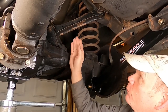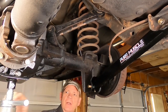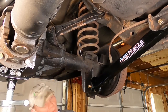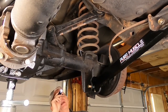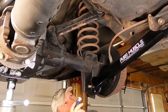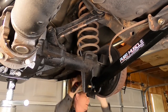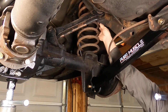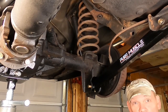I'm going to try to find the sweet spot, release the tension on these arms, and tap these bolts out to get the trailing arms out. I got this bolt here on top of the diff out — just tapped it out, basically just adjusted this under-hoist screw thread. Got as little tension as I could on this junction and just tapped the bolt out. The other one is a little more tight — I think I'll try to get the impact on it and just try to screw it out and let the threads do the work since it might be under a little bit of tension. By the way, when you take the bolt out, the whole trailing arm will just fall on the ground.